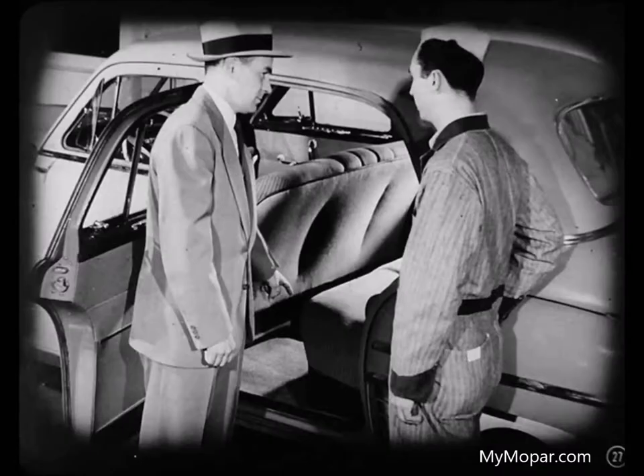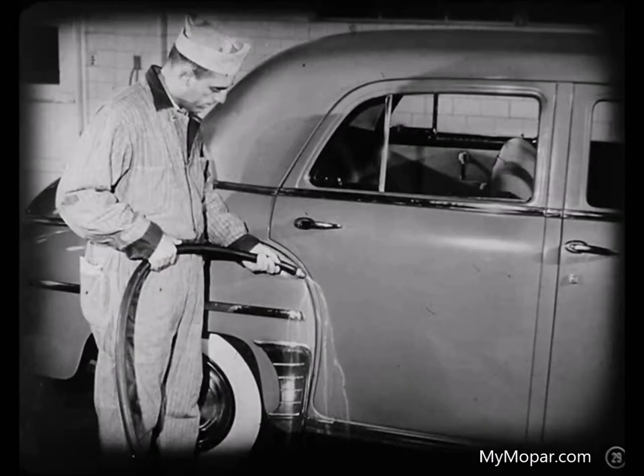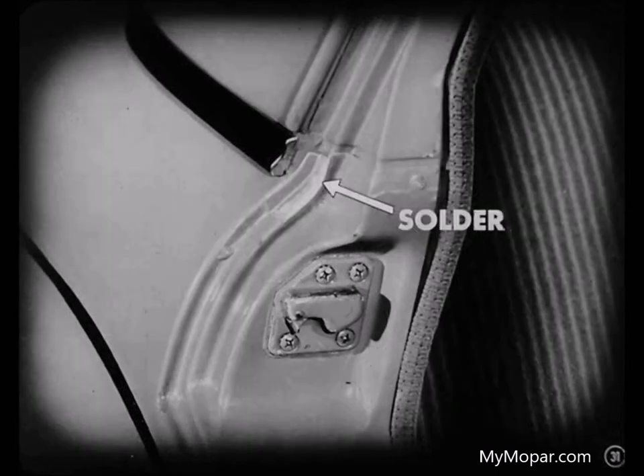By the way, Joe, what did you do for that customer who was telling me about water wetting the rear floor mat in his car? Well, I wasn't sure where the water came from myself, so I took out the back seat and carpet, and then I water tested the lower half of each back door from the bottom up to the belt, and each was okay. So then I went up... Wait a minute, Joe. What if you had found a leak at the rear edge of the door? If you got a leak at the section of the door called the dog leg, seal it temporarily with dum-dum. Close the door and play water at that point. No water goes through, you'll know that's where it was leaking.